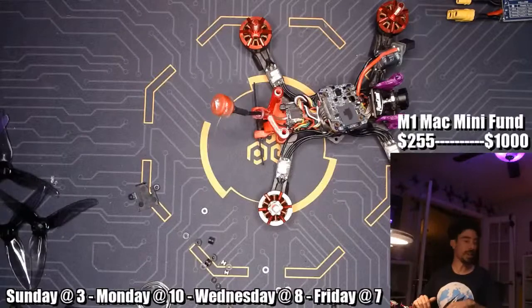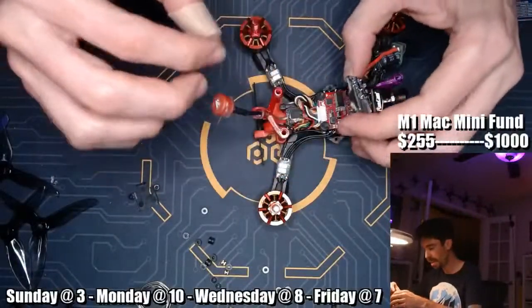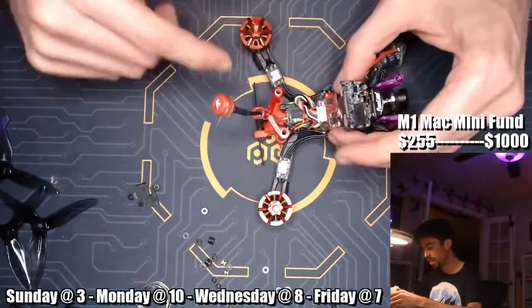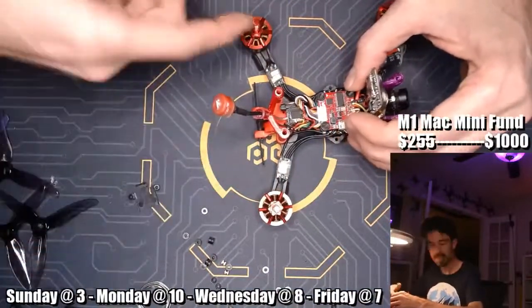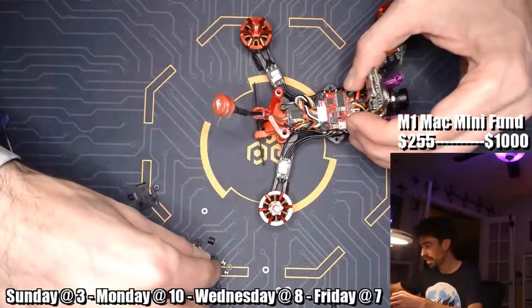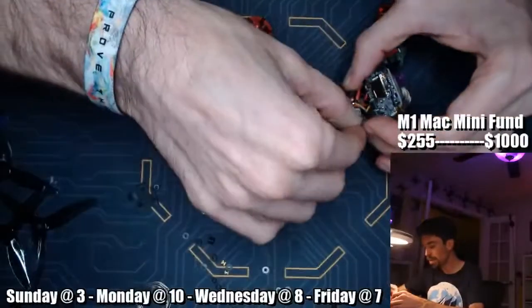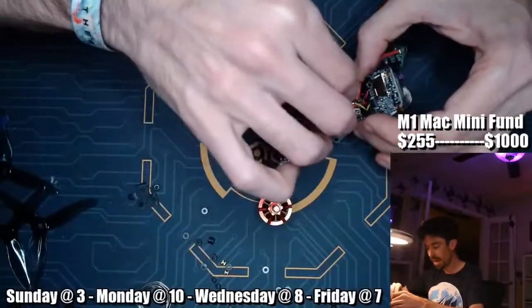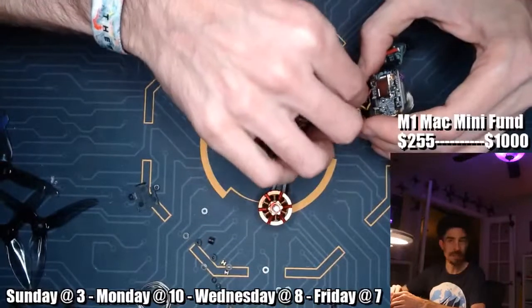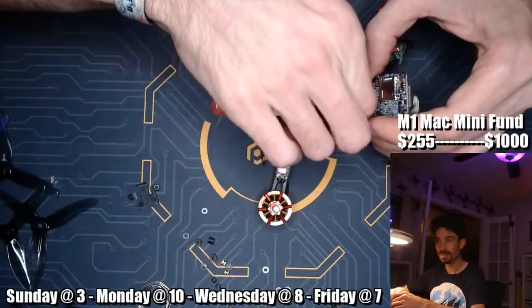And those props are indestructible, and they fly great because they're only a 40 pitch, and they make big power, so they'll make plenty of power to pick up. This thing is 270 grams all up. Wow. But it doesn't care. 1804s, it just rails. They're on an 850. I wouldn't run them on a 650. They would melt that. For sure they would. You wouldn't need them though.